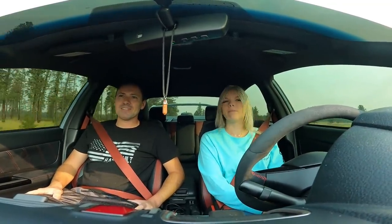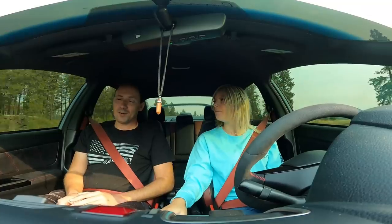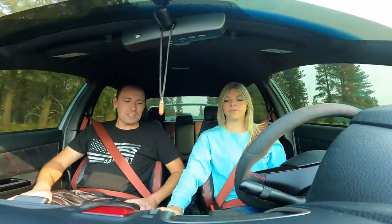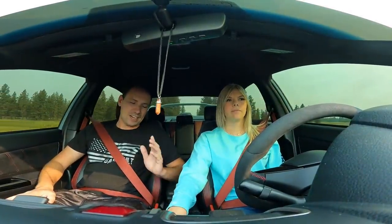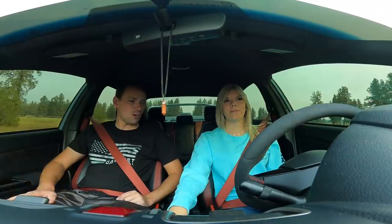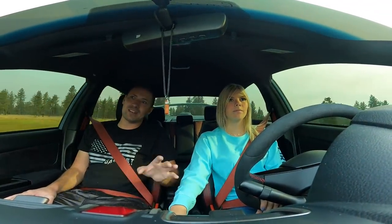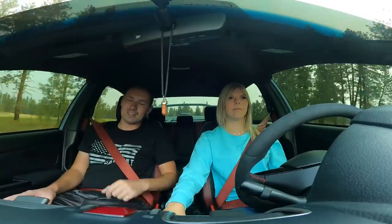I hit my head on the freaking headrest that hard. It's only fast when you flat foot — you just have to have more confidence. I went second, third, kind of did that. This thing has one hell of a clutch — it doesn't work great for gear changes in general. With this ACT clutch it's not going to be as smooth as a triple disc. You have to push harder on the shift because you have one disc versus three discs. This clutch doesn't always stop the disc fast enough when you're doing flat foot shifts really fast — that's why you get locked out. Triple disc is really better for flat foot shifting. You can do it like a stock car.